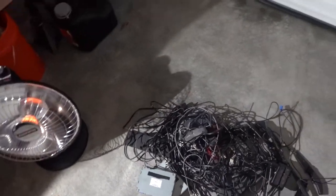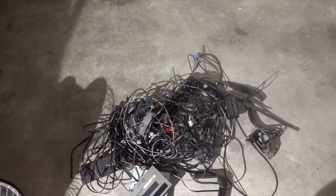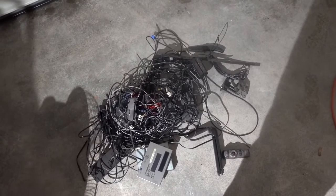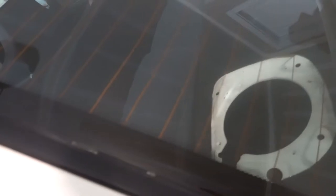There was a bunch of AV equipment in the car — things like a GPS system, TV tuner, all kinds of TV receivers and stuff. This car's AV system was all throughout the car. As you can see, I pulled out a ton of wiring. Luckily, none of it was wired into the actual harness itself, so I didn't have to do any wire repair — I just had to fish it all out and cut a couple of places. That was a big effort. Unfortunately, some of those pieces were on the back windshield, and there was this strip of something — some kind of sensor — and when I pulled it off, it kind of damaged the molding. I doubt I can get a replacement, so I'm going to try to clean it up as much as I can.